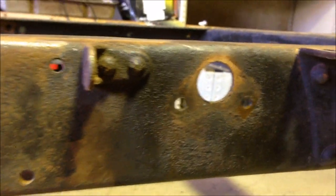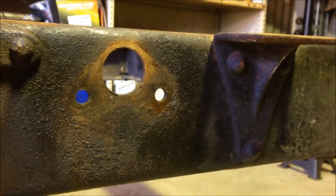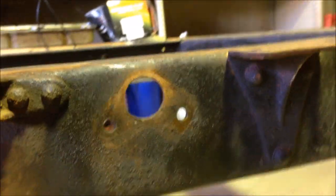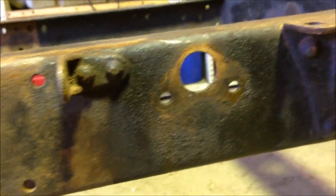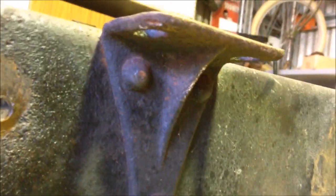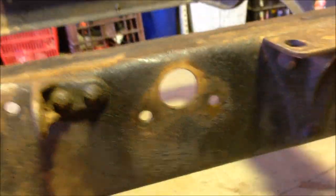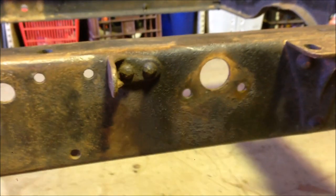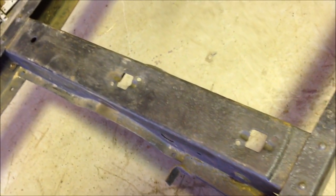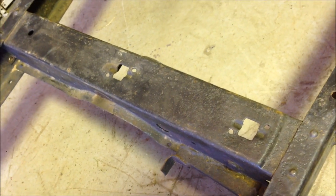So there are a few things that will always keep this chassis uniquely AR, or very early Model A — one of the first chassis made. Obviously things like where the side brake, the handbrake, is. That hole isn't on the later chassis, and all the bracketry is cast instead of pressed steel. So all the little brackets are cast — pretty cool. And that centre cross member is different too, not that you'll be able to see it once it's all together. But those holes are different to the standard Model A's.